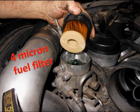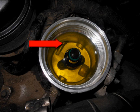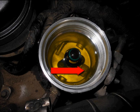When we remove our filter, let it drain out. As you can see, it's pretty fine. It's going to filter from the outside in, so if there's any contamination, you can see it on the outside of the filter. Looking at the bottom of the bowl, make sure we have no contamination, because on the left is where the fuel enters, circles around, and goes out on the right, returning back to the horizontal fuel conditioning module.